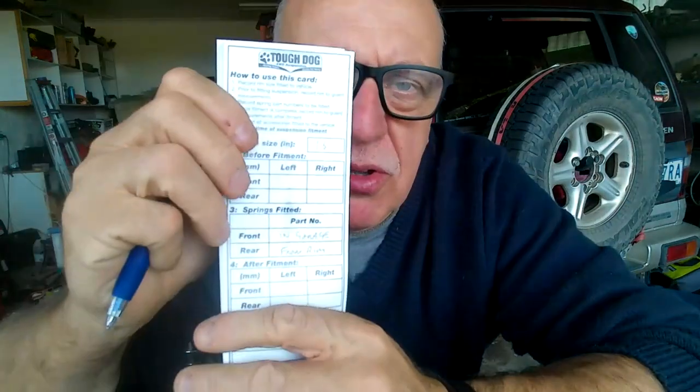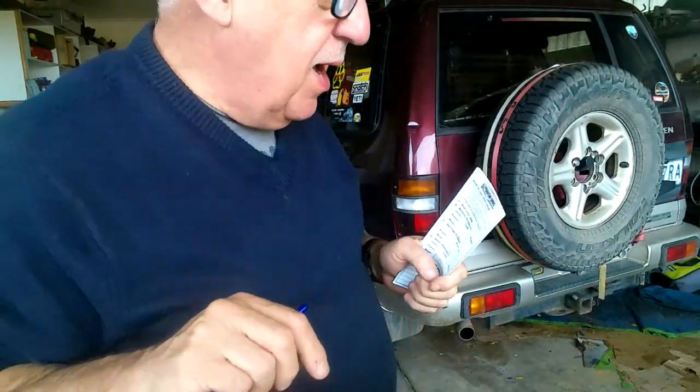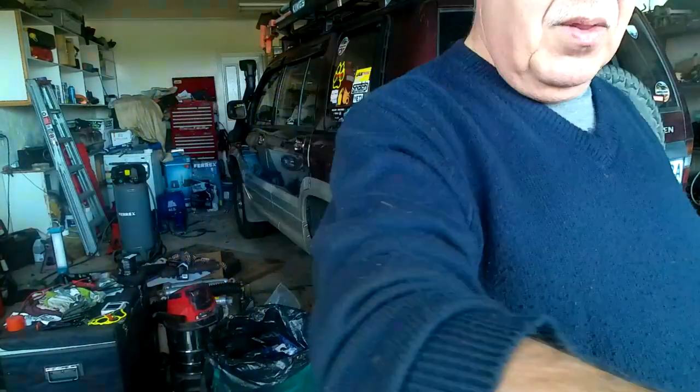Thanks for joining me, and today we're going to be doing the Tough Dog suspension, and at least I'm going to do the measurements on the cards that I talked about on my last video. So I did some measurements on the driveway, and now I'm going to do some measurements while it's level in the garage. Now the measurements on the driveway were a bit odd because on all of them I had three that were identical and one that was 20 millimeters higher than the others, but it could have been a slope on the driveway and the fact that the steering wheel was turned to the left. So we'll check it again now. Now it's on the level and we'll see how we go.